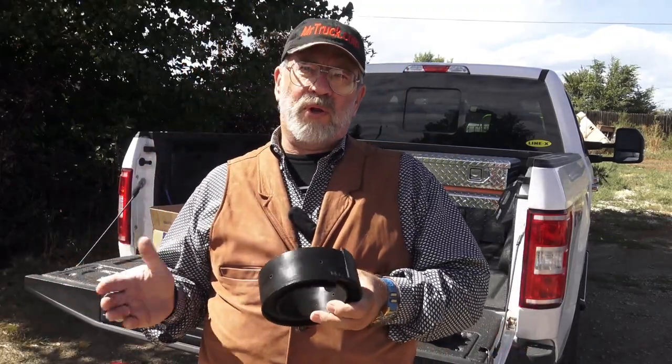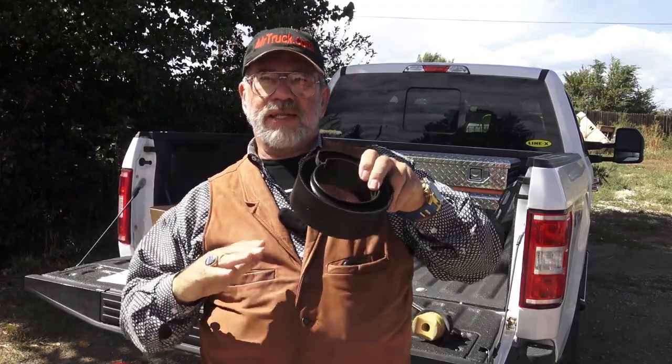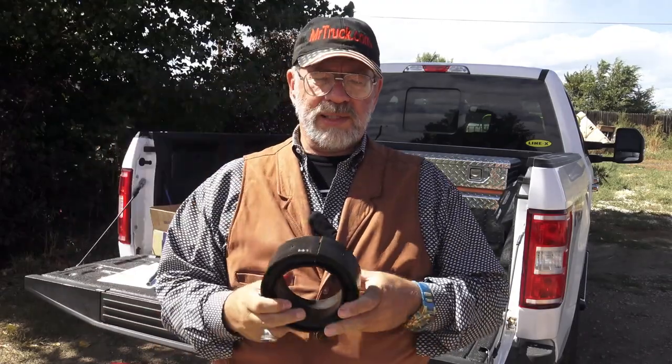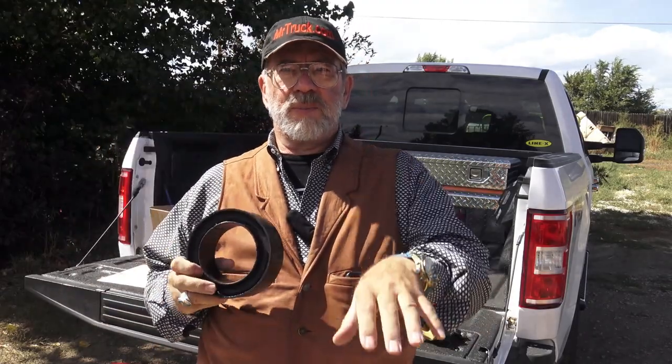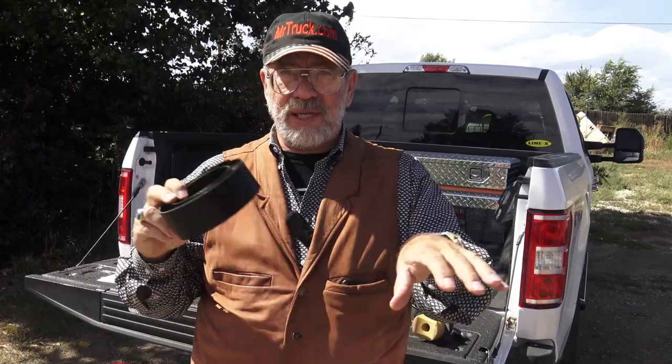But on a bumper pull, you got a teeter-totter: you got a trailer on the back pushing down, and of course pushing that down makes the front go up a little. So if you have these front Sumo Springs, it'll control how much movement the front has. Instead of bouncing forward and back like a teeter-totter because of your trailer, it won't do that. So you'll have better control of the front. That's what these products are all about: better ride, better control, better trailering ability, and safer trailering ability. And that's what I like about them.